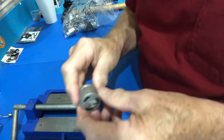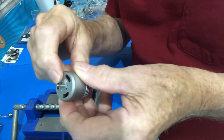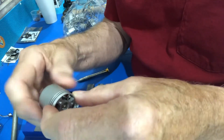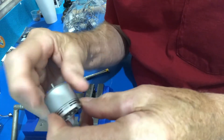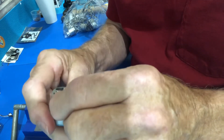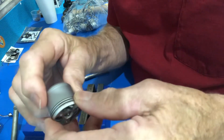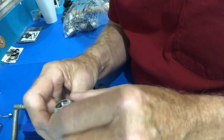It's just an old motor and the prop lock has been taken off. Usually nothing ever happens to these, but sometimes you can get dirt inside, can't blow the dirt out, and you're going to need to take it apart. Or you may get a piece of metal in one of these — they are magnetic inside the field, so the metal will stick to the inside.